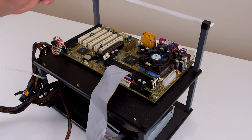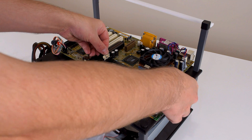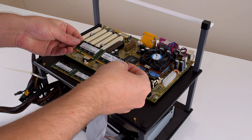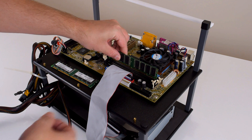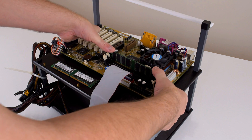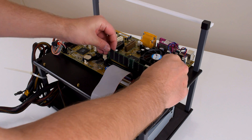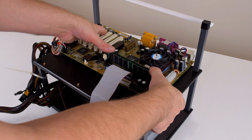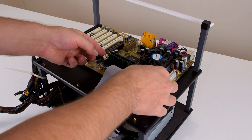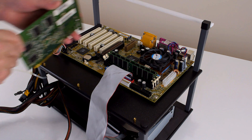For gaming the video card is very important. The Aldi came with the GeForce 2 MX, which is a very good value card, however we're gonna go with the top dog, the GeForce 2 GTS. That card is basically double what the GeForce 2 MX is — it has double the pixel pipelines, double the texture mapping units, and double the render output units. Also the clock speed is improved, running at 200 megahertz, and it has DDR memory compared to SDR memory.